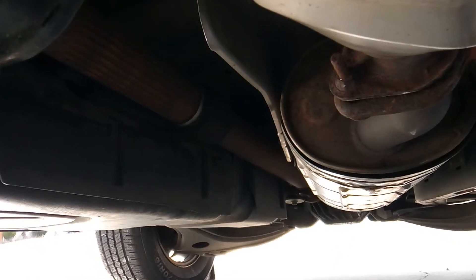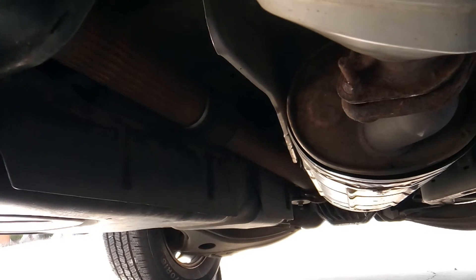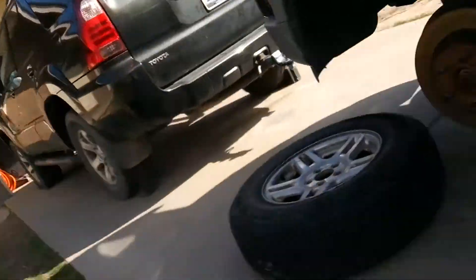As it's running, the fluid will pour out of here and basically what it's doing is self-adjusting the fluid level. Once the fluid is done pouring out, you put your cap back on and you're good to go for a test drive. Everything is back together and I've already started it. I do have an exhaust leak — the leak is at the junction, right here.